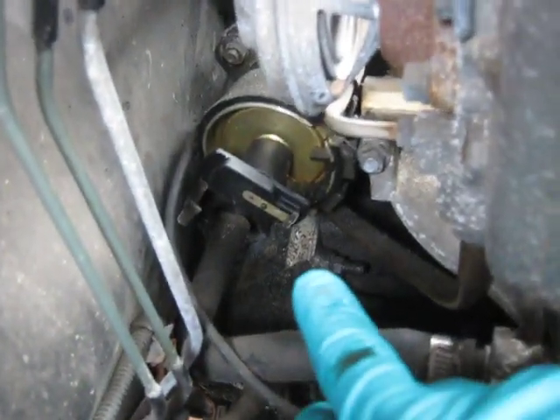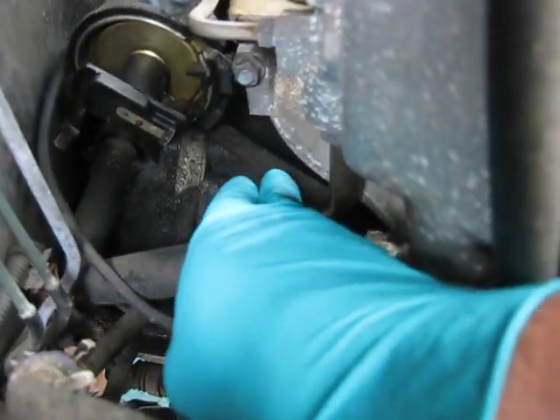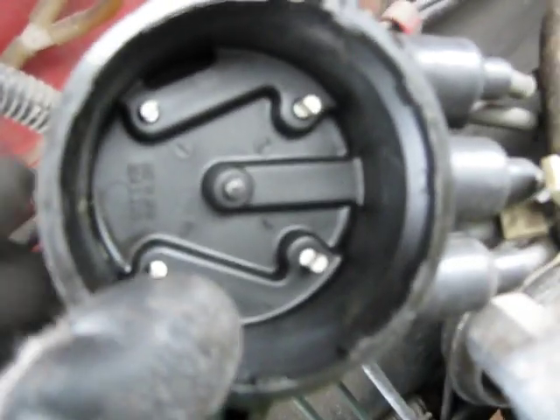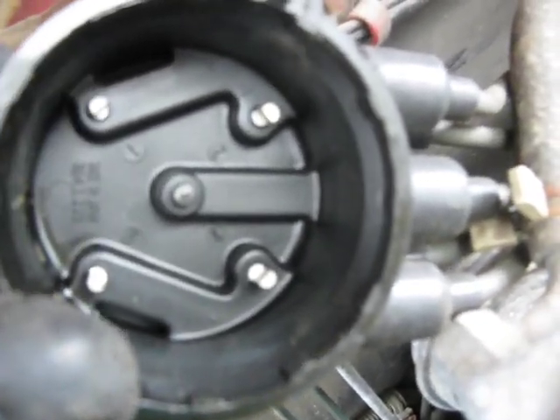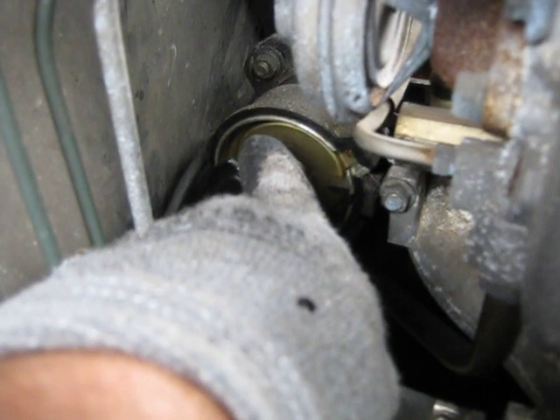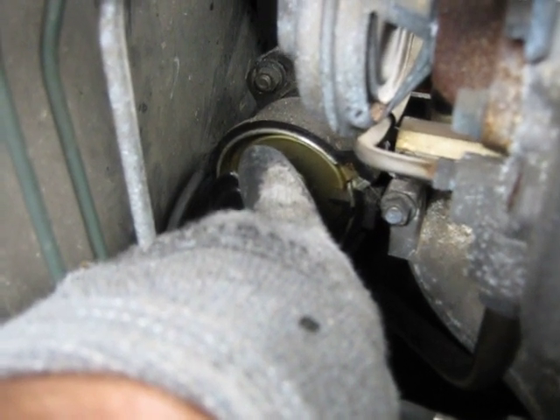The other way to confirm here is to make sure that we're not 180 degrees out. We get to the distributor in the back and we want to see the rotor — the rotor is literally pointing down towards this EGR tube, and that is position number one inside the cap. Because if you look at the cap, you'll see a lot of them are numbered, and number one is this top guy up here. So when it's facing down like that, it turns out to be this corner here. If you're pointing up where the number one wire looks like it's going to connect, you're actually pointing to number four.